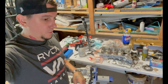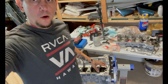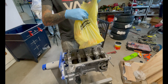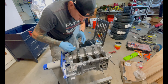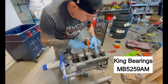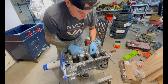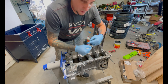I ended up having to go to AutoZone to get a new piston ring clamp because the one I got on Amazon is a complete piece of crap. We're going to get our main bearings in, do our plastigauge and all that, make sure everything's within spec. I have the oil squirters sitting in some chem dip right now. You'll know the difference between the mains and the rods because the mains are going to have an offset groove. Give them a quick clean on the backside before you install them. I wouldn't suggest putting any lubricating oil behind them because you need these to stay in place and it can potentially change the tolerance. So I put them in dry — I'll lube the inside, not the backside.